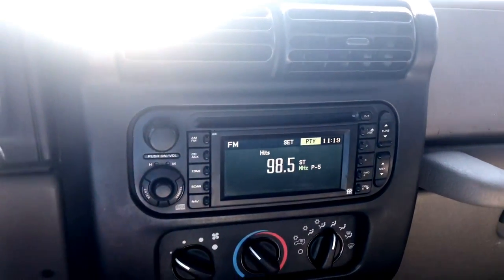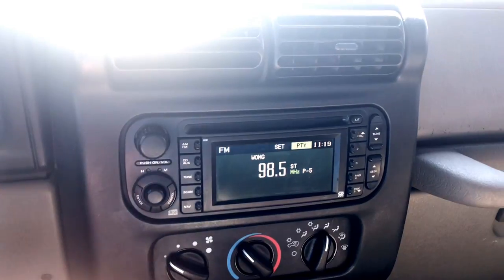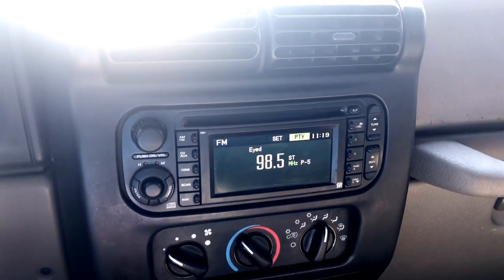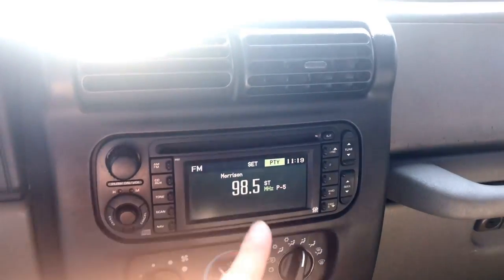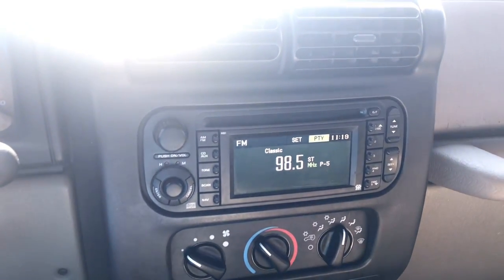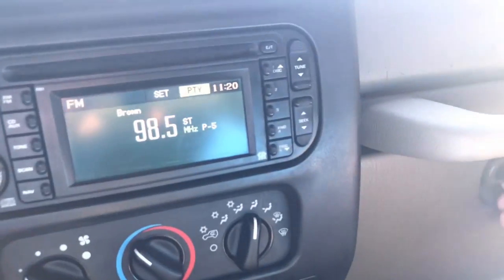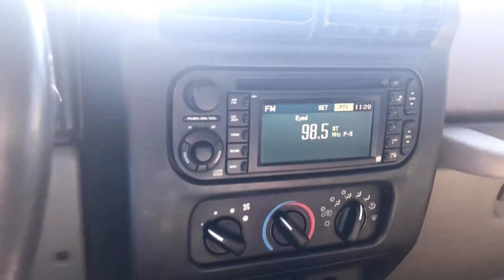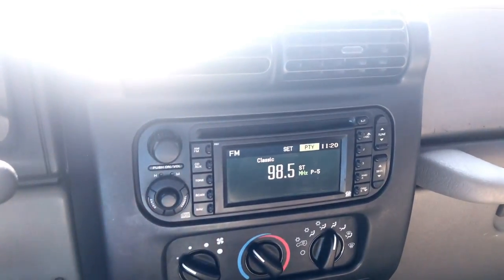I know a lot of people look on forums online and they talk about needing the disc changer option to add a CD player — that's true if you go with some of the aftermarket ones. But if you go and buy the Mopar one online, which is extremely hard to find now, you press CD-AUX and it'll change to whatever you have plugged in as the aux, which would be the iPod hookup. There's a little computer that gets stored behind the dash behind your instrument cluster, and the cord comes through down in the glove box. There are a couple of different ways to route it — down through the floor and up through the console — but it's expensive, so eventually I'll get around to purchasing it.